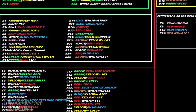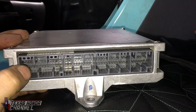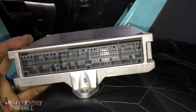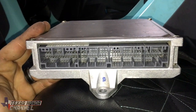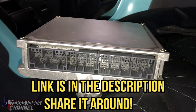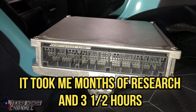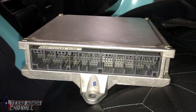This is just going to be a quick rundown. A1 would be that connector pin right there, A2 would be the connector pin right next to it, A3 and so on all the way across — 1, 2, 3, 4, 5, 6, that's A6. I will definitely make sure to put a pinout picture showing wire colors, because there's nothing out there for the Pilot. It's going to take quite a while to make this pinout, but I'm going to show you exactly which wires on the harness I used for the Apexi Neo.